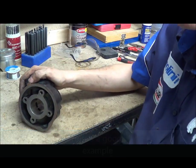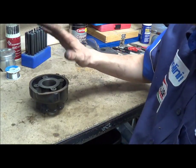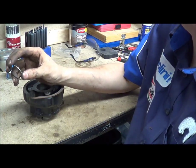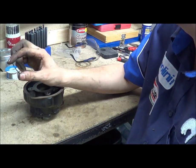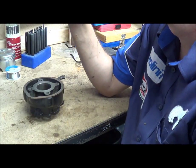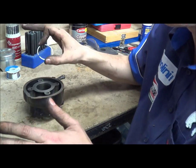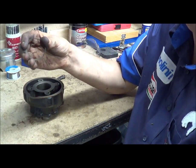It really messes up your cylinders usually, and it's not a good day out. Back to ring gaps. The rings have gaps for two reasons. Number one is you'd never get them on if they were a complete circle, but that's not the main reason. The main reason is these rings need to be able to expand.